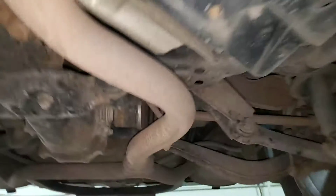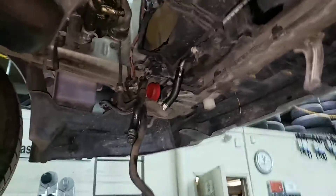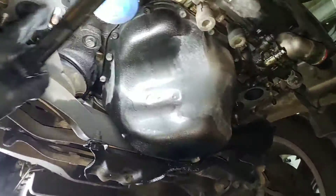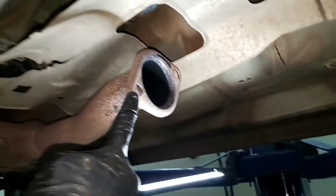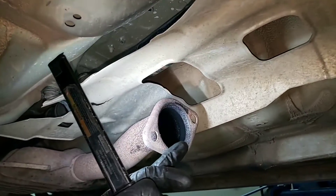We're back under the Subaru with some of the bottom pulled out. For the exhaust, it's three bolts on both sides at 14 millimeters. As you come back there'll be another 14, and then where the two couple themselves, a 14 and a 12 — the 12 is the one you want to turn while you hold the 14 in place.